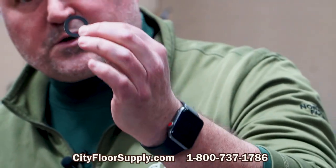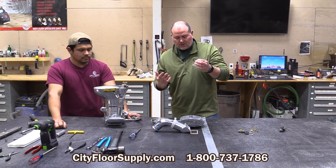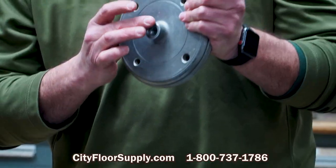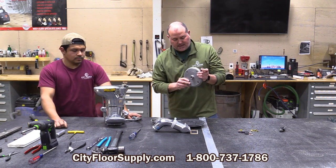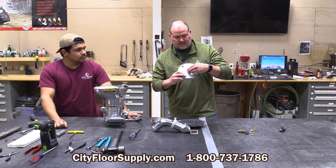You want to make sure that you put that washer back in. It's almost like a crush washer, but really what it's doing is keeping this edge here — this surface from seizing onto the steel that it goes up against. Again, that will help you not to unseat the pinion gear.